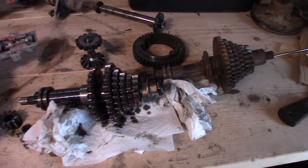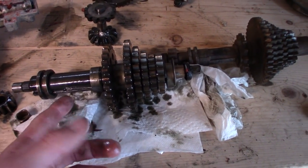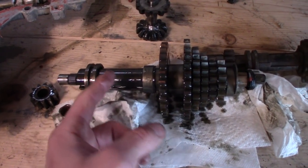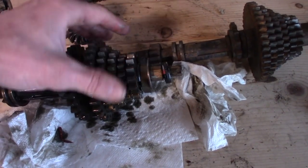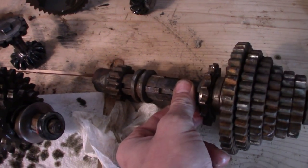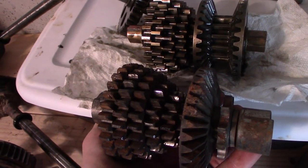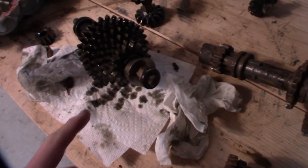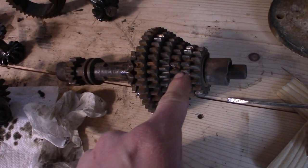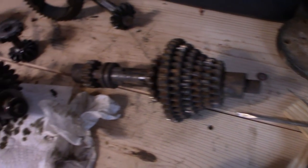This is something I wanted to look at when I had this all apart. This is the MST-205 drive gear — this is where you select your gear. I put the shift keys back in, but this collar slides up and down to select what gear you're going to be in. Basically all these gears are freewheeling until you select the one you want and it locks it up. This is the 820, but this one has four shift keys, which is obviously a little stronger, and it also has a reverse chain as opposed to a reverse gear. I compared and contrasted the parts — they're actually so similar that I took a couple of gears off this shaft, the gear-select gears, and was able to replace them with 820 gears. They are exactly the same internal diameter, which I found quite fascinating. So you could probably swap 820 gears onto an MST if you wanted to.